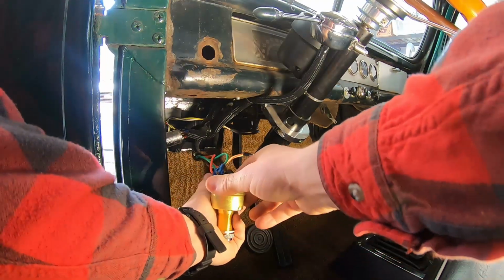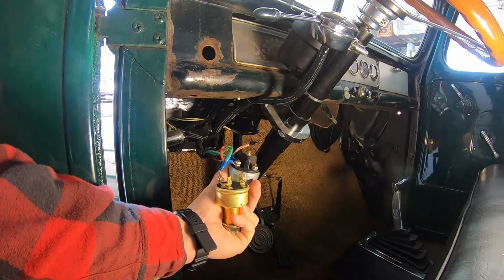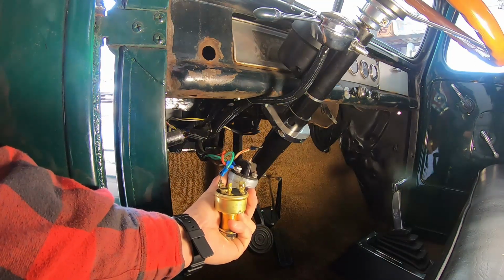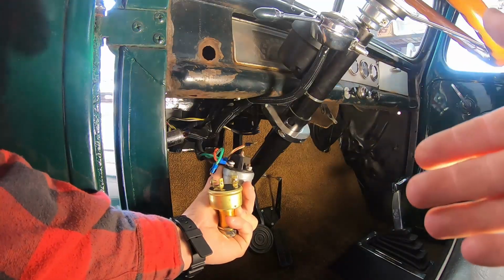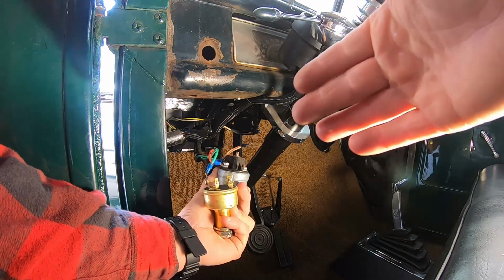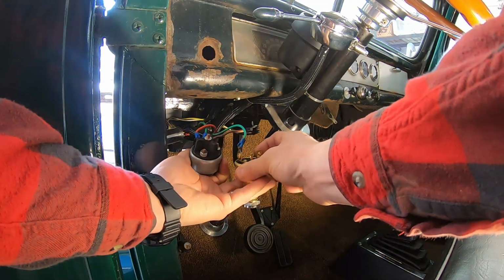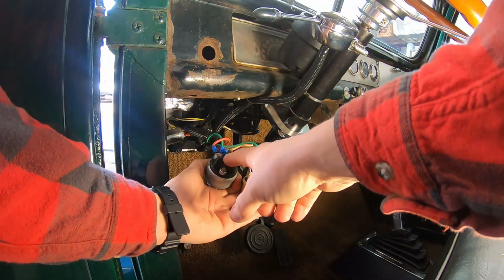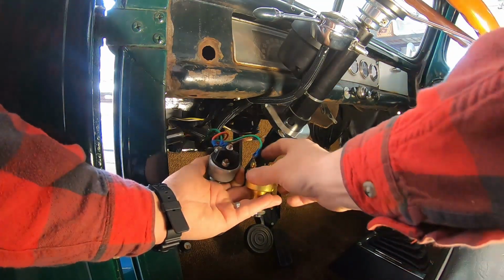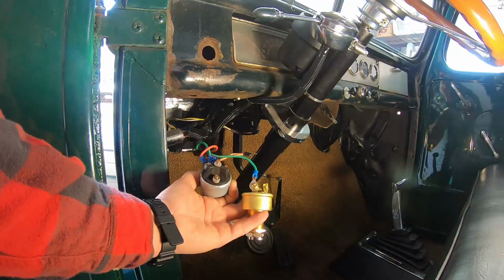All right, one of the things I like to do to make this a little simpler with changing these switches out, especially in the custom world, you never know exactly what wires they have going where and what wires are powering up. I've seen red wires for grounds, I've seen black wires for hots. I wired this truck up so I know exactly how this truck is hooked up, but in other cases where possibly someone else did, you really would never know. They could use all one color wire. So what I like to do is each terminal I take off one at a time. This was going to the starter, the hot wire. I'll take that wire off and I'll immediately put it on the new switch where the starter wire is, and so forth. I'll just keep going one by one. That way you never lose a wire or have it misplaced or anything like that.